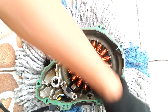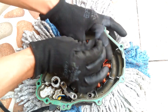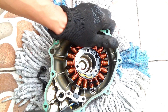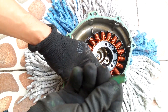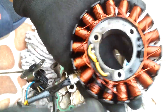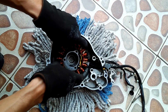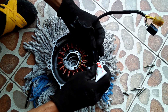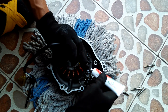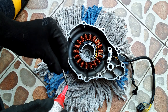At this point the easier way forward is to buy a brand new replacement stator. This part has a lot of metal on it and I don't think it is cheap. I always want to save some money, so what I did is manually rewind the burned-out coils — I made a separate video about rewinding so please check it out if you want to save money and rewind the stator yourself. Once you have the stator sorted out, either by buying a new one or refurbishing your existing stator, it's time to put it back into the left crankcase cover. The service manual calls for applying sealant to the cable wire rubber grommet and thread-locking compound on the bolts, then the rest is just the reverse of the removal procedure.